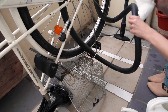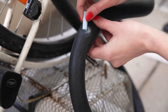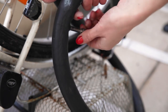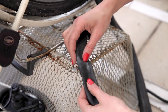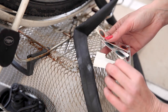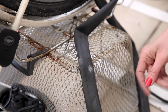Now we want to stick a patch on the puncture, so dry the tube while remembering where the hole is, then mark it with some chalk. Now we can deflate the tube knowing exactly where our hole is. There are several kinds of patches available — some you cut yourself, some come ready-made, and there are different sizes. Obviously the larger the hole, the larger the patch should be. If your hole is anywhere close to a centimeter, it would be better to just replace the inner tube with a new one.